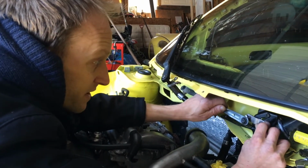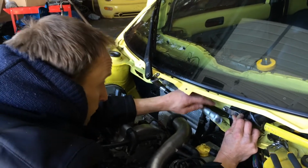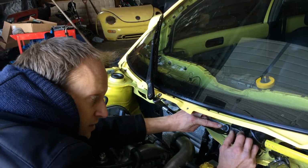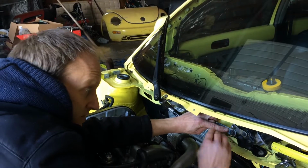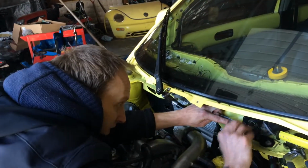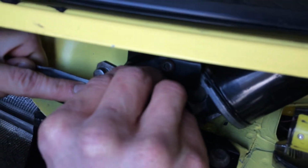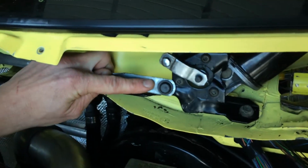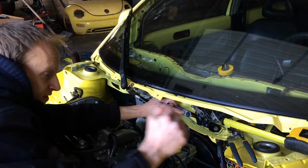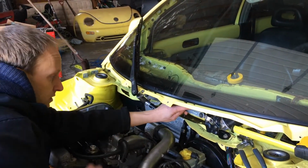I think we've got to remove maybe a hair under a quarter of an inch. 3/8, didn't you say? Yeah, or is that more? I think what I'll do is remove a little bit from here, then maybe pop this into the socket and take little by little off, going back and forth to each side, making sure I'm still even. Before welding? Yeah, because I can also adjust this guy here. There are a lot of teeth here to grab onto, so I can do minuscule adjustments on the wiper arm as well. My whole hope was that this would be an added in-between, doubling the amount of small incremental adjustments I can do. But that should work out perfect to get us exactly where we need to be.